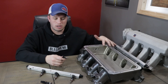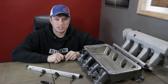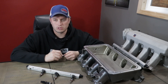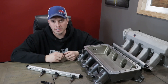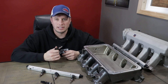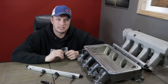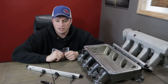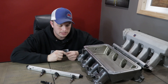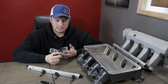When I took this whole combination apart — the intake off the car — prior to that we had gone out and raced the car. The last two times we raced it, the car was down hundreds of horsepower. It was pretty clear it had a boost leak or a hot side leak of some sort, but we looked through everything. We changed diaphragms on the wastegates, checked blow-off valves, turbos, everything you can imagine, tune stuff — all of it. Nothing ever made sense. The car was so dead slow, it ran like a bracket car — it would only go 8.70 every pass. Really frustrating.